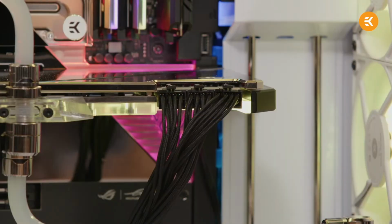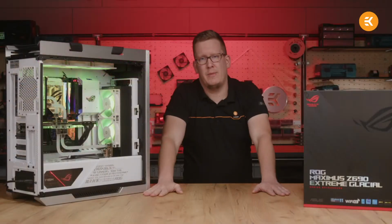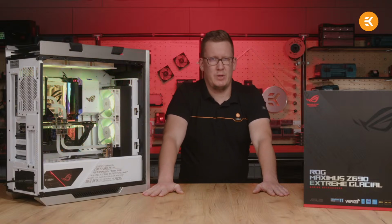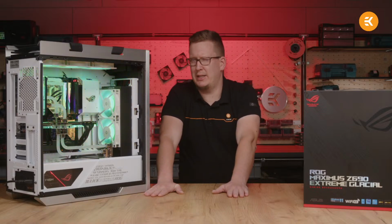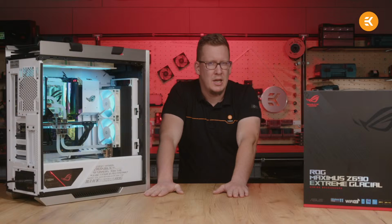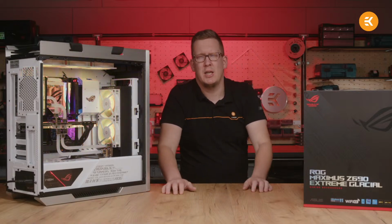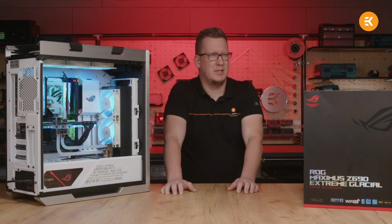Question. I got a question. Can you still delid the CPU using this motherboard and monoblock? I think not. Mostly with each monoblock, delidding the CPU is not recommended. The only monoblock which supported delidding is the Aorus Extreme Z490, which we did. That monoblock was built on the cooling engine of the Magnitude, so you had it assembled from multiple parts, meaning that the CPU part could still go up and down a bit and still work, because it was assembled with some barbs.